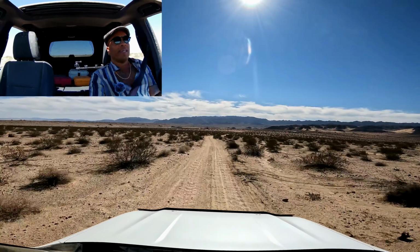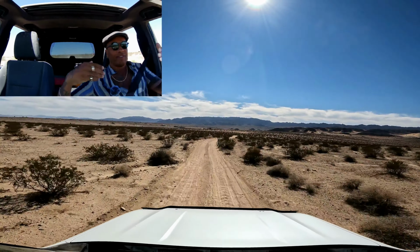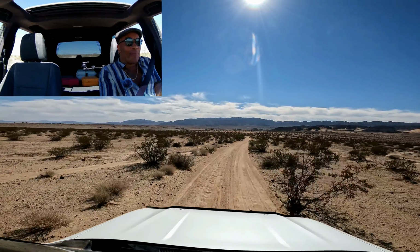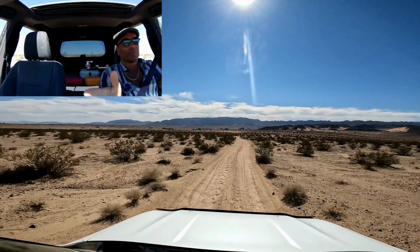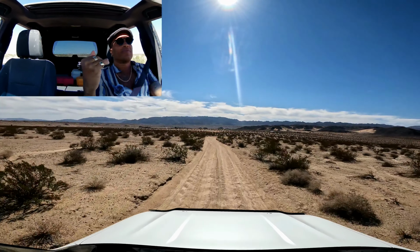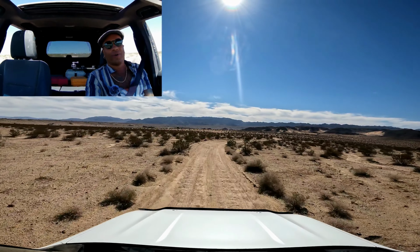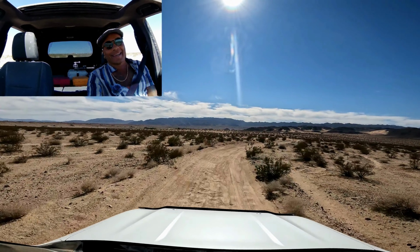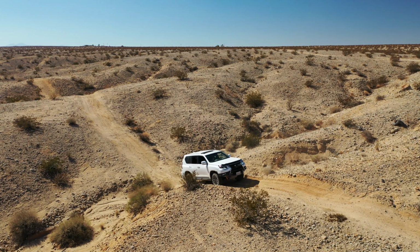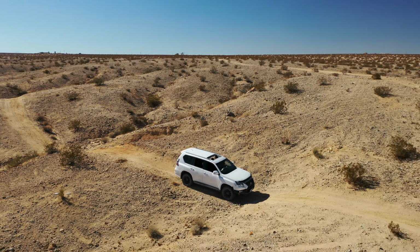So you may not think that that extra 10% from the default 60-40 split to that 50-50 makes much of a difference. But again, and I'm sorry to keep going back to this example of these people with different length legs, it's about a 10% difference, and it's a severe disability and a severe handicap to their mobility. Your car off-road is the same way. Again, it's not night and day. You're going to get around just fine, but if you want the absolute best ability of your car, simply lock the diff when you go off-road every time you don't know where you're going.